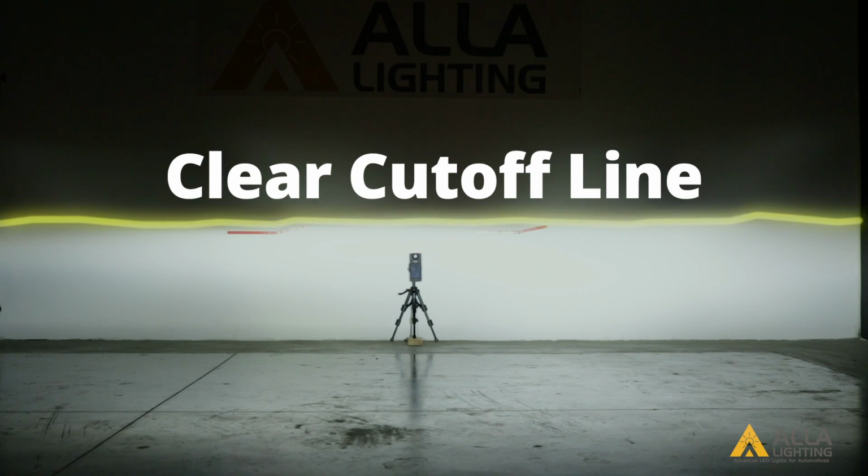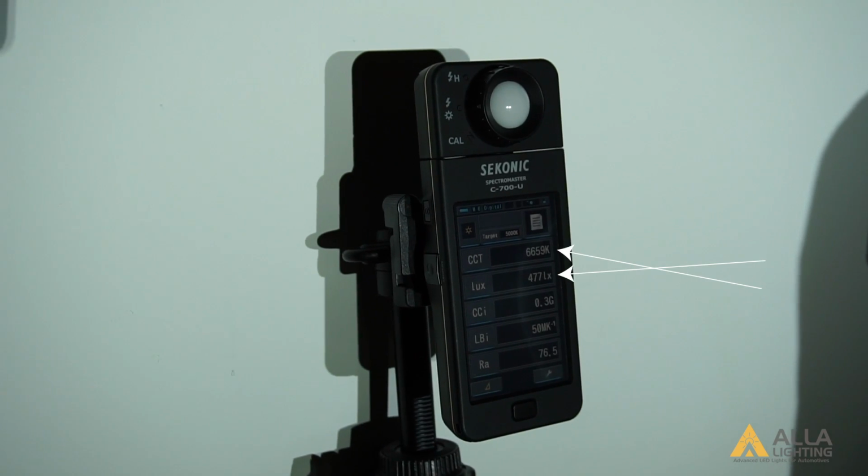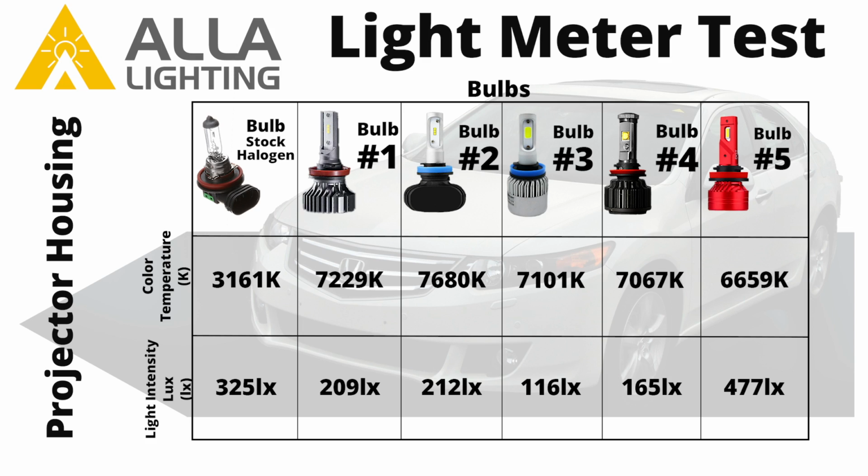Bulb 5 also has a clear cutoff line that is about 28 inches off of the ground. Bulb 5 has a color temperature of 6,659 Kelvin and a light output of 477 lux at the center meter spot, the brightest of the bulbs. Here are all the bulbs together.